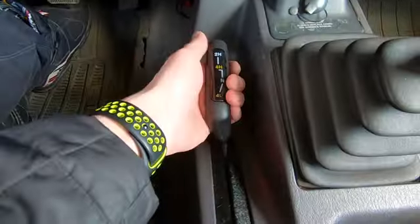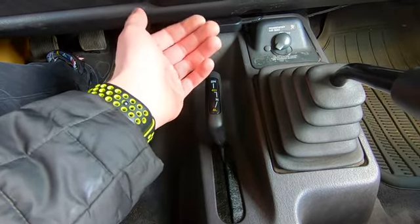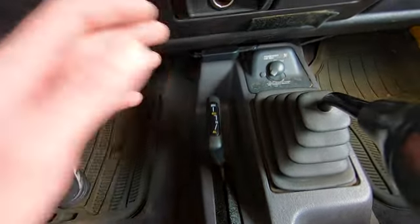Next, I will say put it into every four-wheel drive mode that you have on the Jeep you're looking at, if it has a full selectable like this, or if it's got the knob or whatever it is. So basically go through it, drive it in every single mode just to see if it actually works, if it engages, if it disengages, because a lot of the time people will buy a Jeep and they'll go, oh, my four-wheel drive doesn't work, or my four-low doesn't work, or this doesn't work. And you don't think to try these things out sometimes unless you're actually experienced in driving Jeeps. But definitely check out if this actually works and shift it through all the gears, put it into 4-low, put it into neutral, put it back into 2-high, and put it back into 4-high, and then put it into 2-high. And see if all of them work, and see if it actually drives properly as it should. Now, lucky for me, mine did.